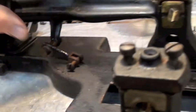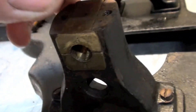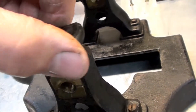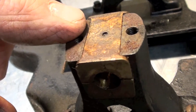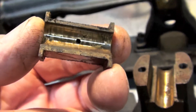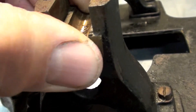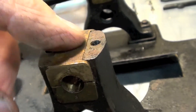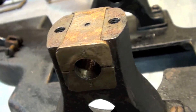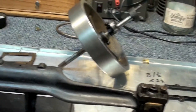The bearings — let me show you the bearings. I wish all engines had bearings like this. Very precision built. This block will turn either way on either side, so not much to mix up there. It didn't have any shims in it. Shims go on this surface and this surface. This is a split bronze bearing and they are excellent — they can be removed for service, stuck back in, a little bit of shim, set them for tightness and you're good to go. Very nice set of bearings in it. The rod bearings and everything were good.